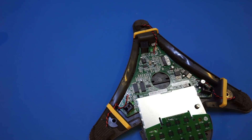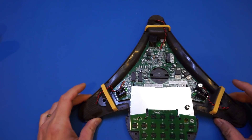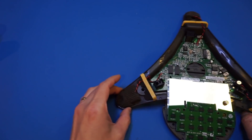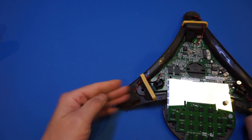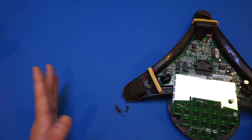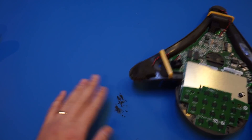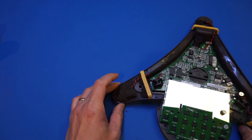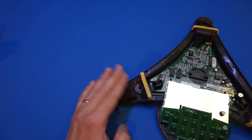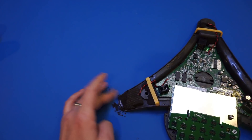Now let's take a look at the microphone placement. For these Polycom phones, we have typically three built-in microphones, one on each corner. Interestingly, these foams over time become very brittle and they just start falling apart. If you remember my teardown videos of early HP equipment, we had similar issues. I wonder if this is just a common problem with these kinds of foam materials — if they had a better choice of foam, it would probably last longer. But over the years, most of this foam just degrades like this — when you touch it, it just falls right apart.